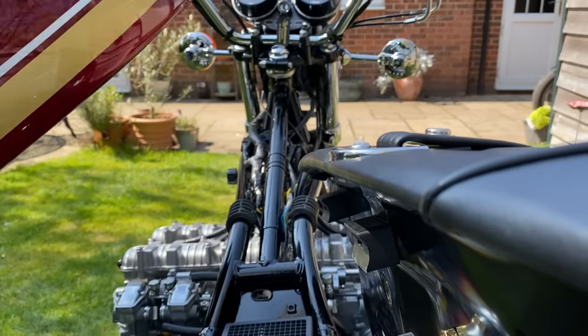I've just had some lunch, come back to the bike and put some more fuel in the carburettors, and it started straight up and idles quite smoothly now. I think it was just running out of fuel. So I'm going to connect up these fuel filters, put on the tank and side panels, and then we'll have another look at it and maybe I'll take it for a ride.